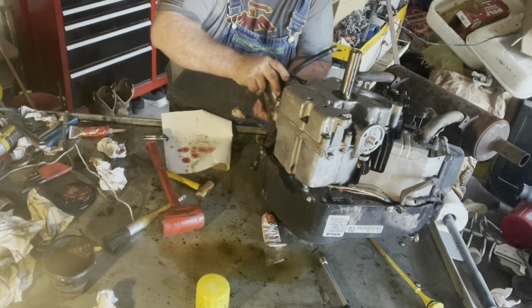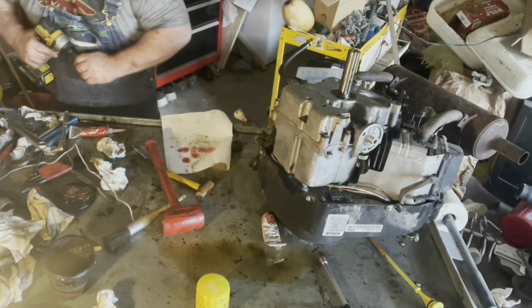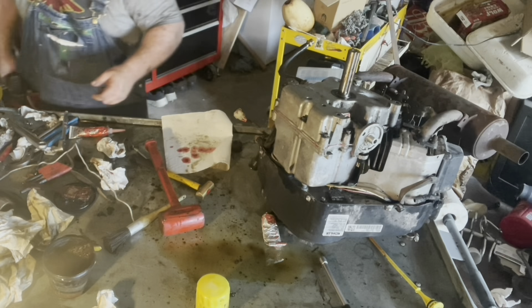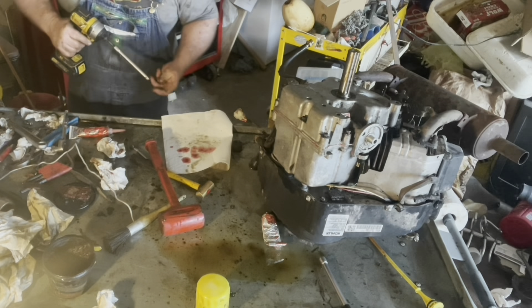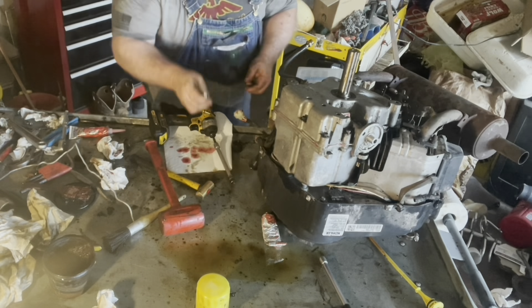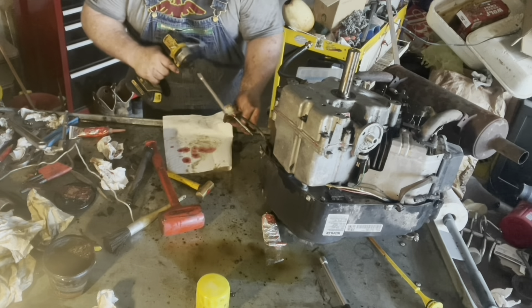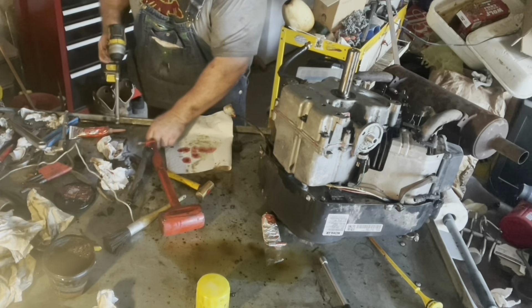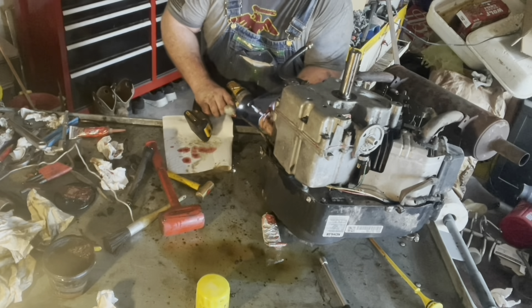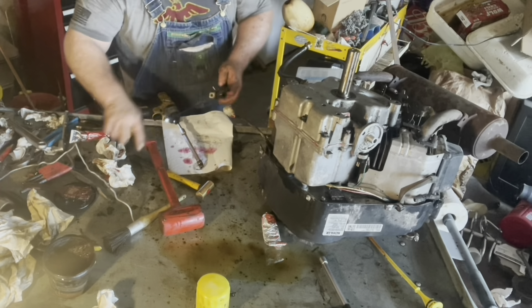Here's our starter — we're going to replace it and put it in place. We'll slide it in place around this hose, tighten both bolts down, then remove one bolt and put the oil dipstick in place and snug it down tight. I'm going to use red silicone around that oil dipstick so it don't leak. I treat each and every one of my customers just like I treat my best friend, and this guy is one of my best friends from long years past — the last thing in the world I want him to say is that Chris said he had all the oil leaks fixed and it's still leaking oil.